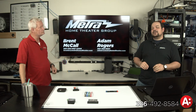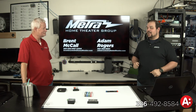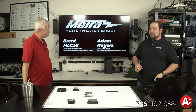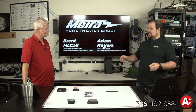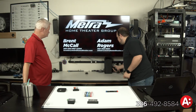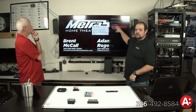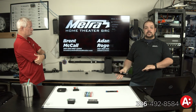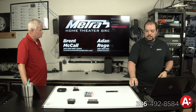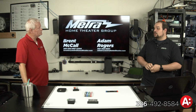So here's all of that to say, what does that have to do with troubleshooting? Well, just that. If you turn on your system with an Xbox Series X and you see a picture and it looks absolutely terrible, it's because at that point it's dropped down to 480p. Most TVs nowadays have an option where you hit a certain button and it will come up with an option for info, or if you switch from one input back to that input, it gives you that info screen. It'll tell you what resolution the content is currently set to.